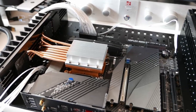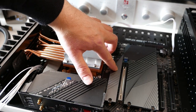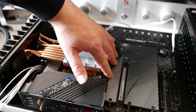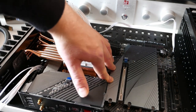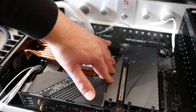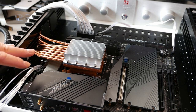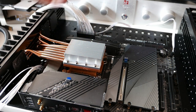Okay, so the other thing you can't see here is actually under this panel, and that's the hard disk. So that arrived yesterday, and that is an Intel Optane drive. The earlier Optane drives, I think the top of the range one is a 900p, there are a variety of them. The earlier Optane drives, the ones they made first time, are much lower latency than the newer ones. So if you are going to get these, look for the old version. I actually had to get these directly from China via eBay. They're not available in UK shops, but these will be the fastest.